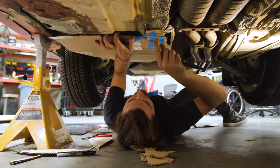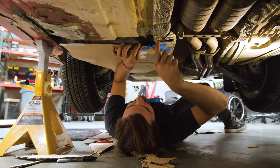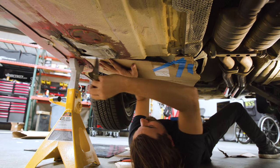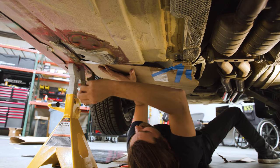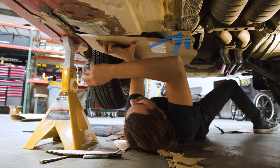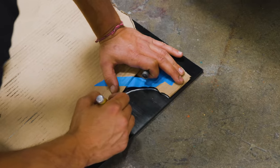Okay, so we'll cut in some short shape like this, make a hole here, mount it there. Then once the welder's back up and running, I'll weld a little plate from here, like a little rectangle that hangs over that this will slip into and that we can put holes in and fasten it to. I think that'll work just fine.